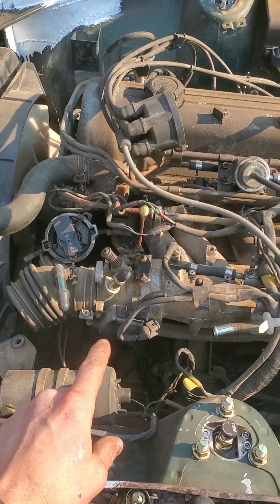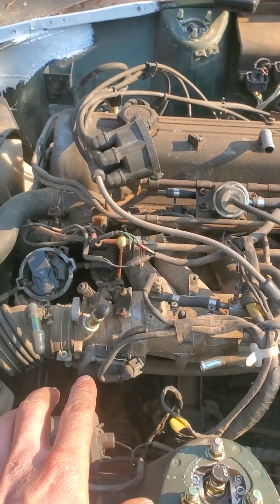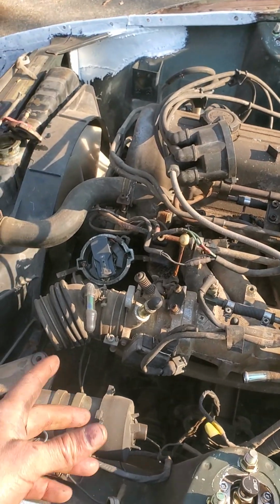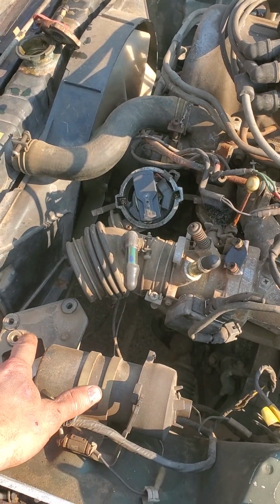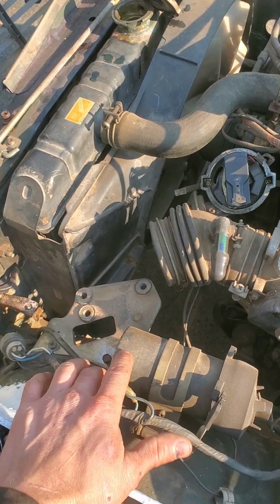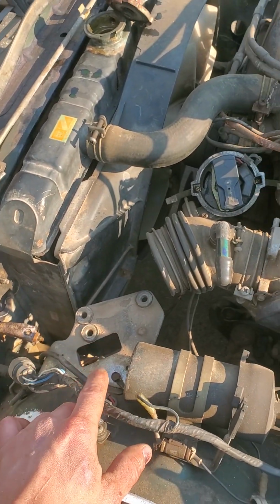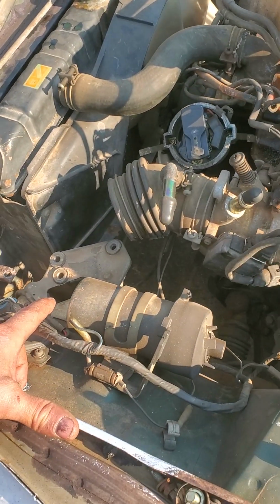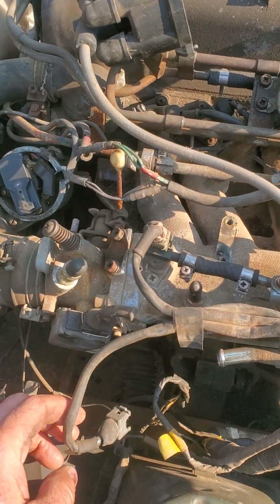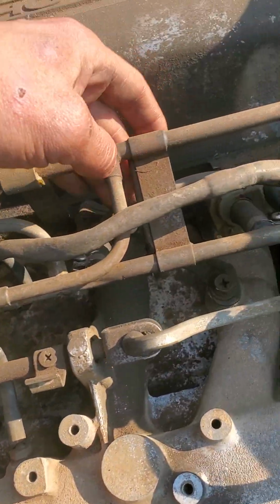Next step for the engine, I already bought it, and it's actually inside of the house, but I need to work on installing a fuel management system that removes the need of the old intake air mass flow sensor that used to be here. I still have it, but I think it's working intermittently, and it also removes these old school sensors that I don't need. Plus it also comes with a new wiring harness for all the injectors.